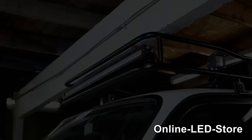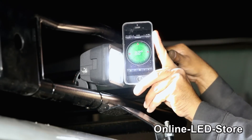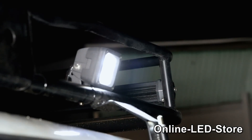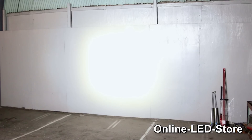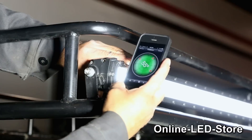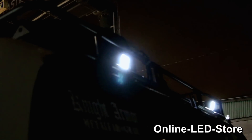Now that we've got our light bars installed, it's important to angle each light properly. The recommended angle would be to have your light bar tilt down about five degrees. We're going to utilize a Tilt Meter app on our phone, and while we're doing this at night, we can see the adjusted light output right away. You can see that the light output shoots directly to the front of the vehicle, covering the road right in front of you. With the rest of the front lights on the bull bar and the lower front bumper already covering the immediate ground, we're going to leave those lights straight without tilting. We have two of the Mavericks Cubis lights mounted on each side of the car — one straight and the other tilted down — so we're covered for both the immediate ground and for seeing far.